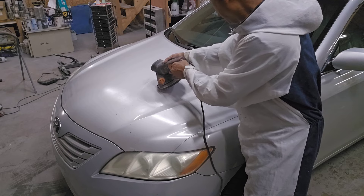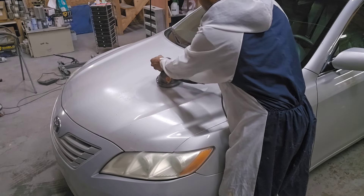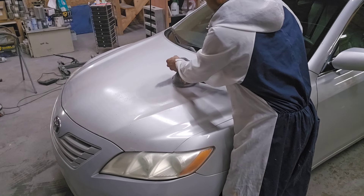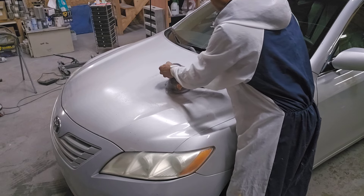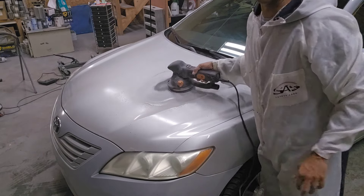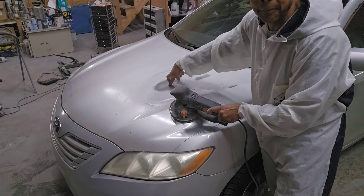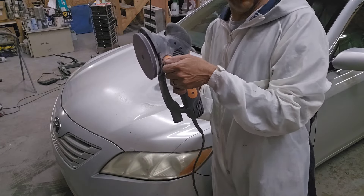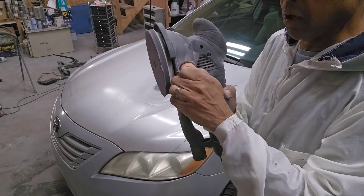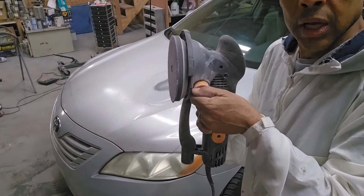Let's turn up the speed and see how it does, because right now we're just running at a four — I'm going to turn this up to a six and see how we do. Okay, I think that's enough for you to see that it is rather quickly going through the base coat — it went all the way through the primer; I'm already down to metal pretty quick. I'm not sure if it's a variation where you can go full DA, full gear, or half and half.